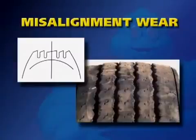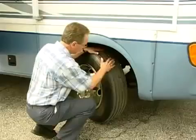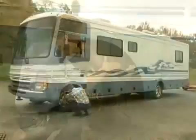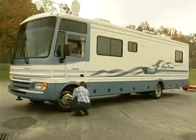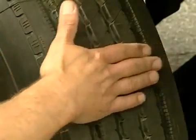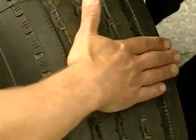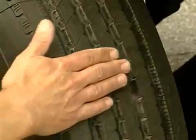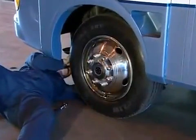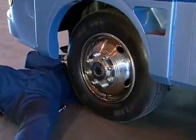Steer tires can develop odd wear patterns. This can best be detected by running your hands around the tread area. You will generally feel dipping or cupping before you see it. Also, move your hands across the tread, feeling for feathered edges, which are generally felt in only one direction. This may be an indication that the alignment should be checked.